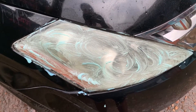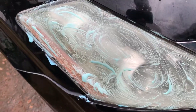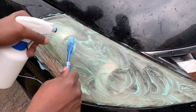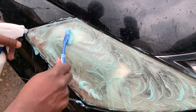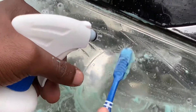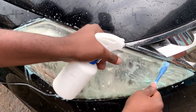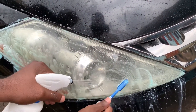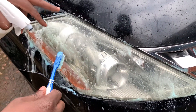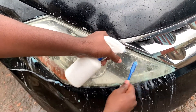So now we're done with this — we shall get rid of this. We get our spray bottle that has our warm water and start spraying onto the headlight, rotating and scrubbing it in circular motions. You can see it coming off. Make sure you try to get the corners and the edges because some of it tends to get in there. So we continue to spray our dishwasher soap with warm water mixture.